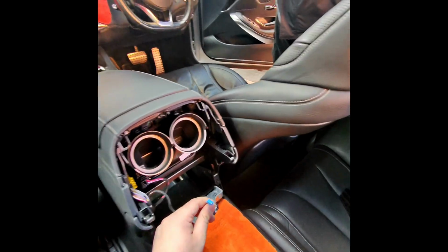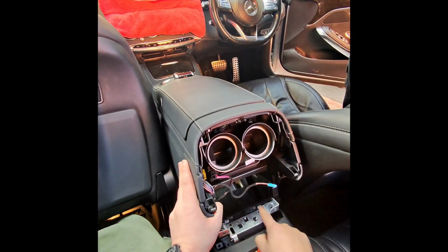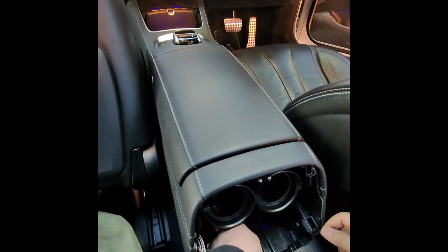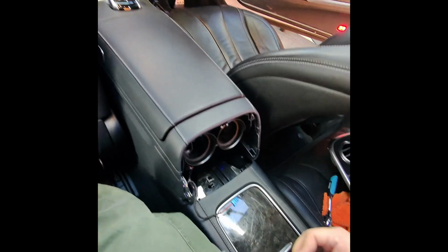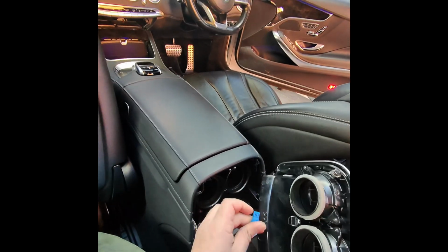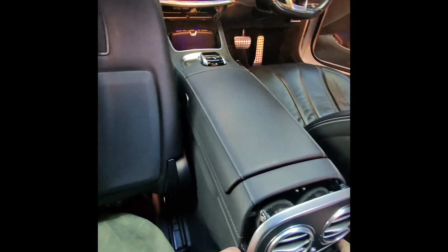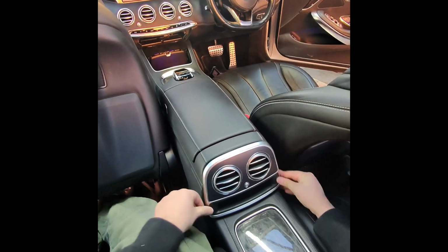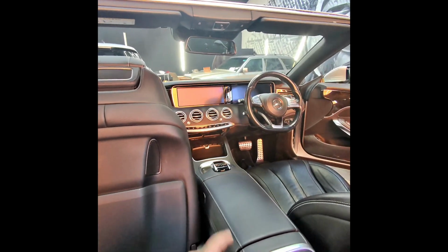This one goes on the AC vent, but before that we're going to put this back in and put these 4 screws. Put these 4 screws back in. Plug this light back and put 2 Torx 20 screws here. And you can connect this blue plug back in here. From the back at this point, now we're gonna go towards the front side and finish it there.